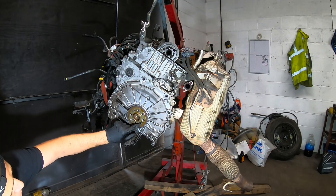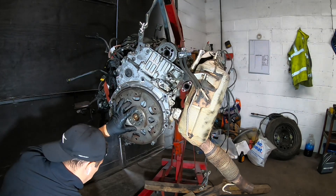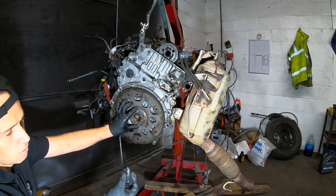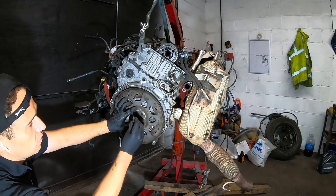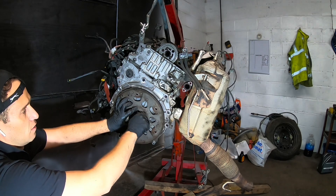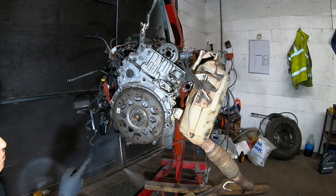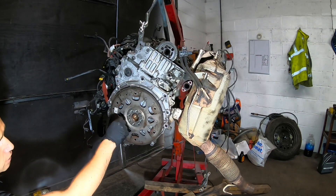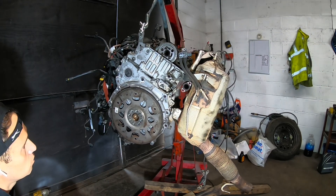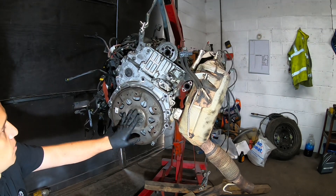Very important — make sure you put back this small plate, otherwise the car will not start. I pre-prepare and clean the bolts, then put thread lock. This serves two reasons: not just preventing the bolt from becoming loose, but it also has the role of sealing the hole, because there is oil going inside and you're going to have a leak if you don't put thread lock. It's 120 Nm, which is quite a lot.